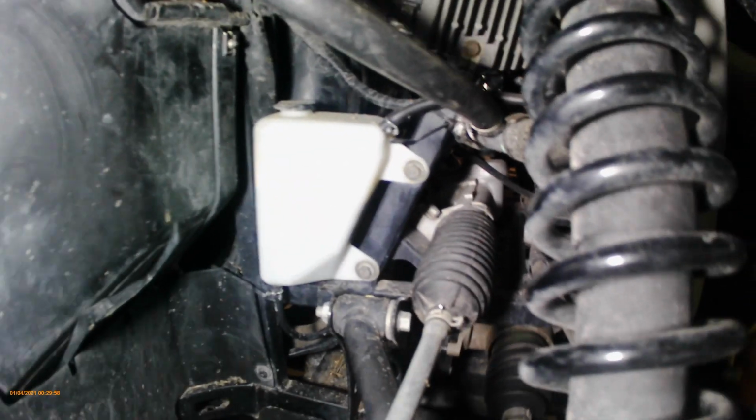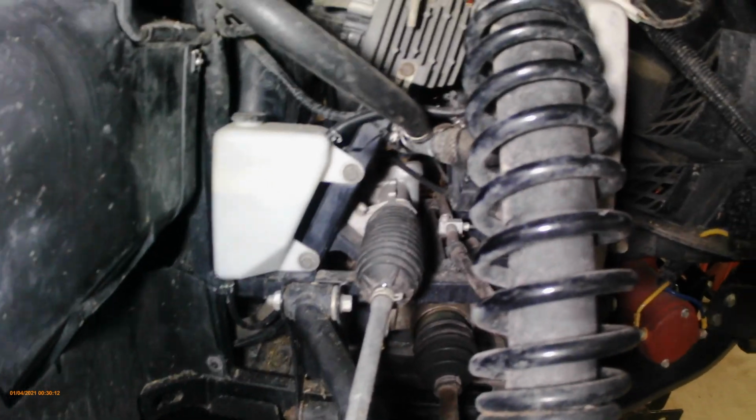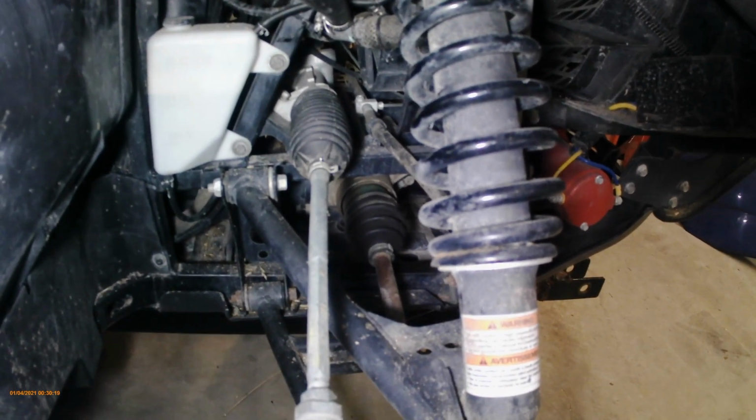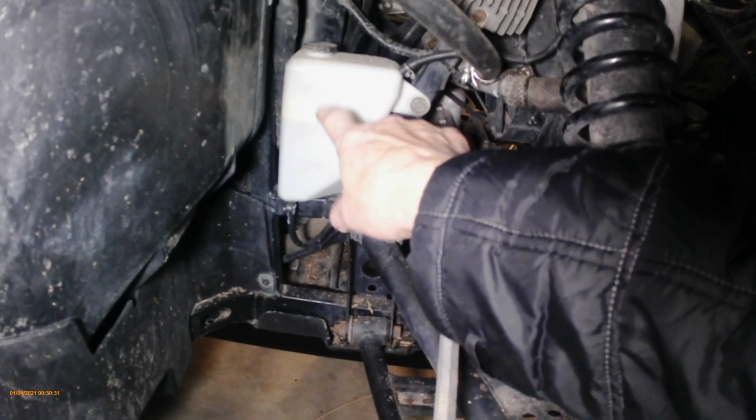And what you do is you start it up. You let it warm up. Not really hot, but leave it in neutral. Rev it up. Just keep revving it. And then when you think it's fairly hot, or if your fan kicks in, then it's pretty hot. You can shut it off. Keep filling the antifreeze up in the radiator if you can. Okay, and then you put the cap on. Make sure you got lots in here.